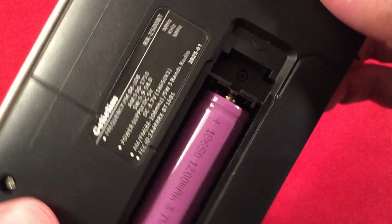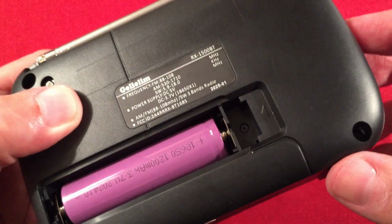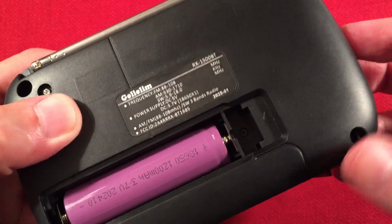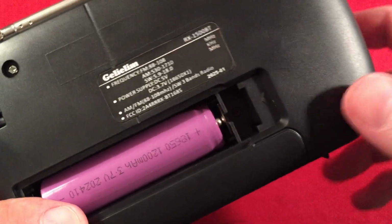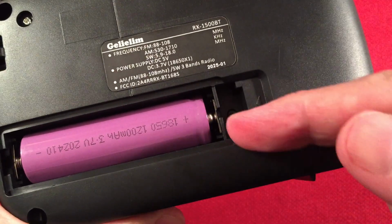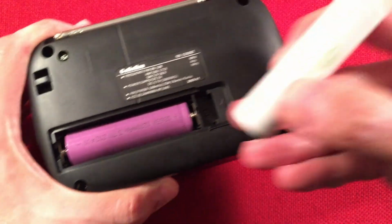If you look here at this radio, you can see that it's got a positive terminal that's pretty wide and shallow connectors there. That is a candidate for modding. When I say modding, you have to be really good with your stuff. So you gotta open up the radio. I would open it up to be safe. And then you can ever so slightly bend that positive terminal forward so you can run flat tops.